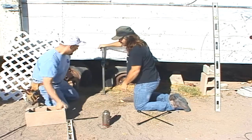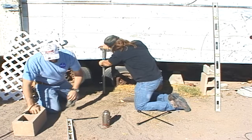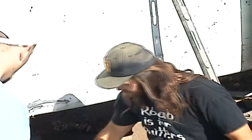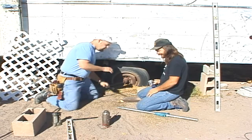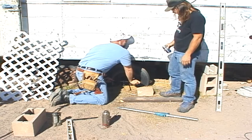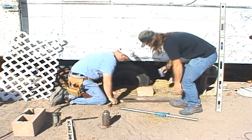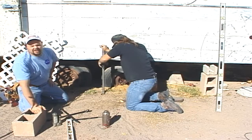What I'm going to do is put the two-ton bottle jack on top of a cinder block. Actually, let's just use the bumper jack here. We've got the bumper jacks right here ready to go. So, Donnie, let me crack the lugs before you get started with that. Yeah, why don't you do the lug nuts? If you crack the lugs while the thing's on the ground, it's a heck of a lot easier — like when you change your tire on your car. If you try to jack it up first and then change your tire, the tire tends to spin. So we're going to do it while we're on the ground. Then once we get it up in the air, we'll have more leverage. Let's get the jack over here. Now you're going to put the jack in place and we'll try to take the tires off after we get it up.